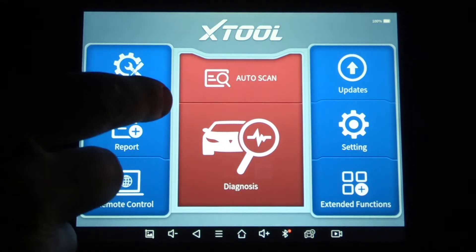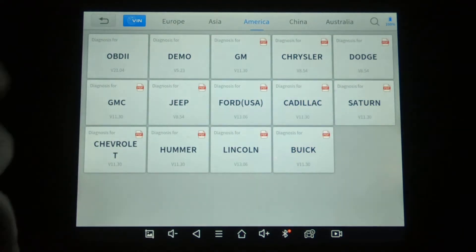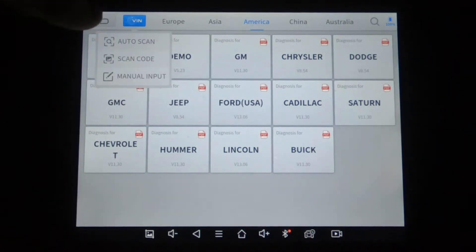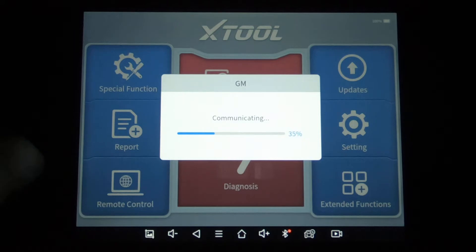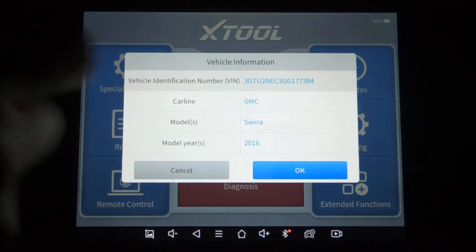This is a four-wheel drive, and I'll go through the different ways you detect the vehicle. If you click Diagnose, you can manually put in what you've got, but if you click up here on the VIN, you've got Auto Scan and Scan Code. This has a camera, and if your door identification sticker has a barcode you can scan it — it'll detect the VIN — or you can manually input it. If you go back to the main screen and do Auto Scan, it'll go through and detect using the computer on the vehicle, detecting the VIN and putting everything in.